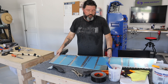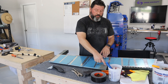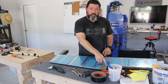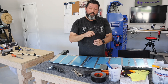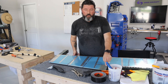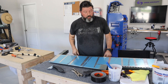It's a little bit of work to drill out those blind rivets, but I learned a good trick for that. It doesn't work all the time, but it works a lot — take a really large bit, like a three-eighths inch bit, start it in the little hole in the center of the rivet and turn very, very slowly, just enough pressure that the drill bit will cut. After a few turns, it will completely take off the head without messing up the skin or the hole, and then usually you can just use a standard punch and push the rest of the rivet through. That worked really well.